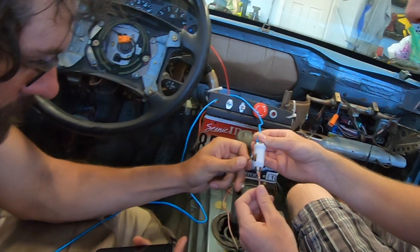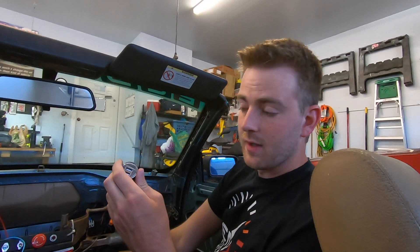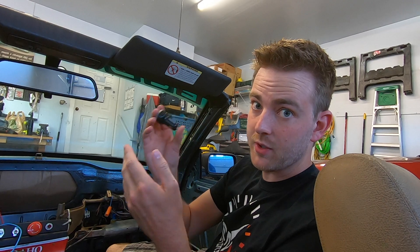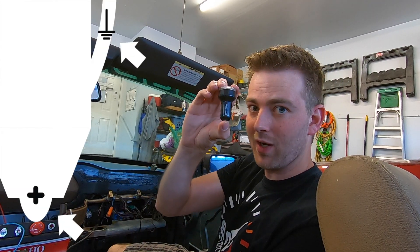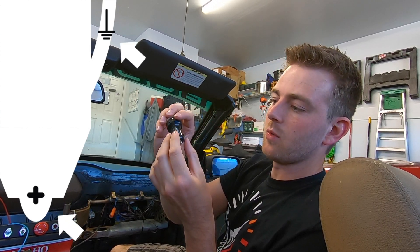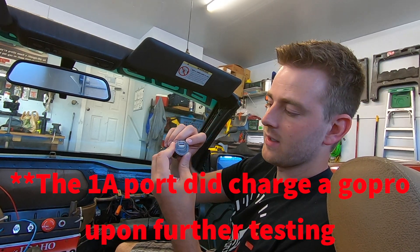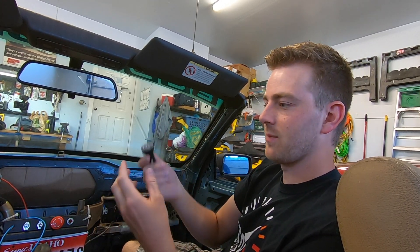I do smell the smoke. Yeah, we fried it. That's fabulous. So a little bit of a modification — we also fried this one. We were testing to see which one was positive and negative and we ended up frying it because we did it backwards. So just so everybody knows: watch the whole video first. This is positive, this is your ground. Now we're going to take this second one apart — it's the exact same thing, but this one has a 1-amp and a 2.1-amp charger on it. It looks like the iPhones don't like the 1-amp setting, so we're going to be using the higher amp charge port to charge our phones. Now it's time to see if we can not break this one.